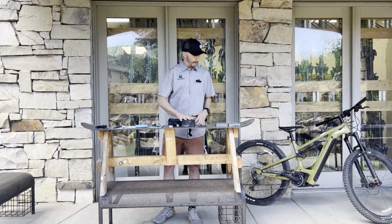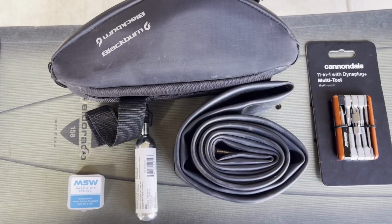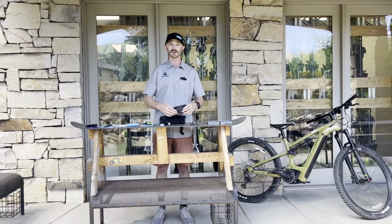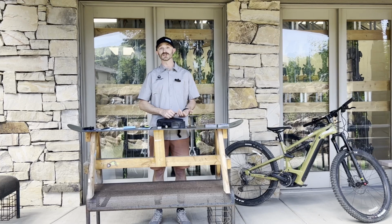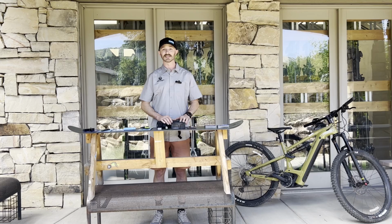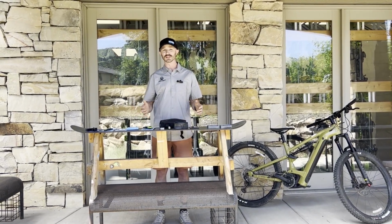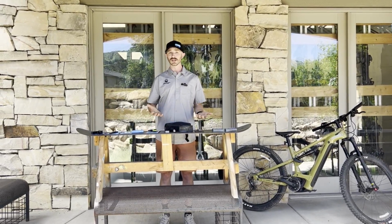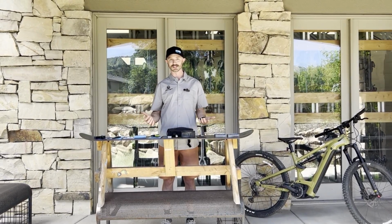So most modern bikes are going to be tubeless. What that means is there's a sealant inside. We've removed the inner tube entirely. Cool thing there is we can run lower tire pressures, gives us better grip, actually decreases rolling resistance. And that sealant inside also helps avoid some of the flat tires altogether. If you run over a thorn, that liquid inside helps fill the hole. You're still riding, everyone's having a good time.